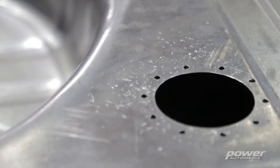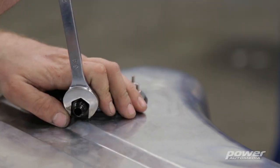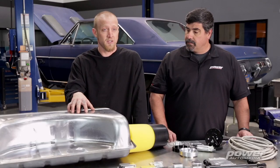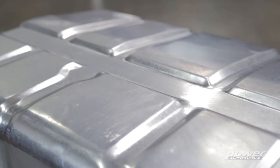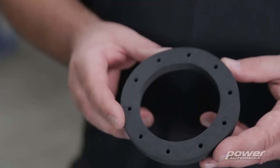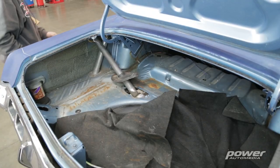Speaking of doing the installation, we're fortunate to have a nice smooth area on the tank here. But this kit is actually set up to allow you to install it even on corrugated areas on top — that's a situation you'll commonly run into with older tanks, which were extremely corrugated with no smooth spot to install the pump nicely. Aeromotive includes a foam ring that helps seal around the entire pump and gets away from those issues. And because we're using a stock-style tank and not a fuel cell inside the car, we're not going to lose any trunk space.